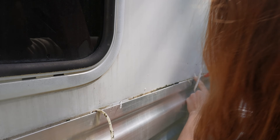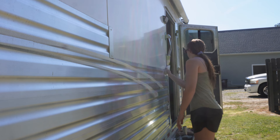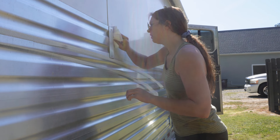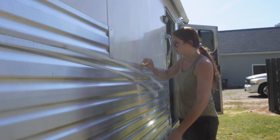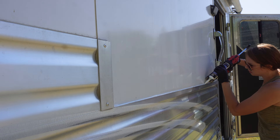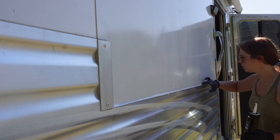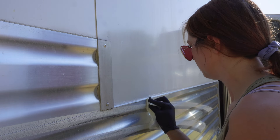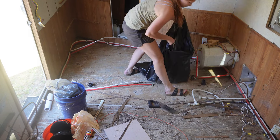I'm using a razor blade and a scraping tool to get all the caulking off, pulling it out as deep as possible. Then I'm cleaning it with some alcohol before putting on new caulking. I highly recommend doing this every couple of years because silicone can deteriorate over time — always a good idea to check the outside seals, especially on horse trailers where multiple panels meet. I'm using an indoor/outdoor silicone; use whatever good-quality outdoor sealant you want, clear or white. I prefer white here so I can still see any residue left deep in the seam.